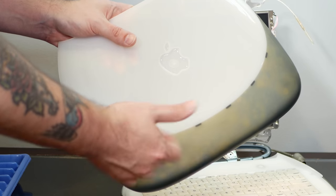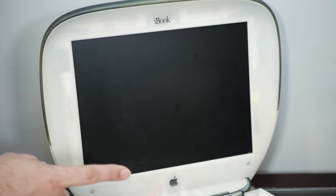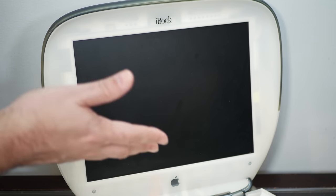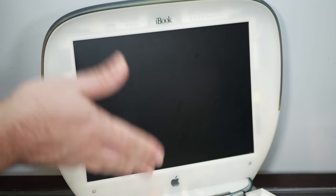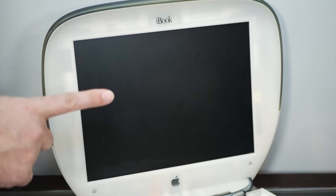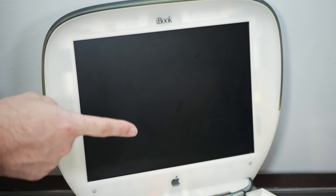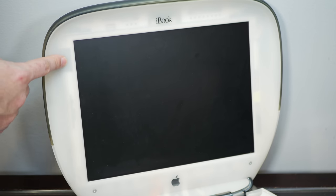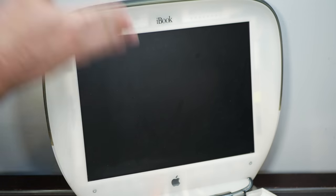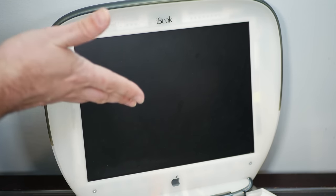I also realized why this plastic is a little bit less transparent than some of the other case mods I've seen. That's actually a good thing because these iBooks are notorious for case cracks, especially around the Apple logo and the screws. It's very common to see these things just completely cracked up, but this one has nary a single crack on it. For this very last run of iBooks, Apple changed the plastic formulation and made it much more durable and in the process less transparent. I actually wonder if this is the same formulation they used in the follow-up Snow White iBooks, which had paint inside the case that made them not transparent, but if you remove that paint it actually becomes transparent.